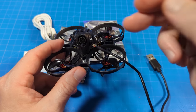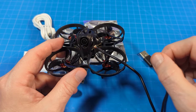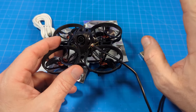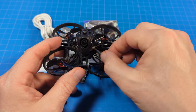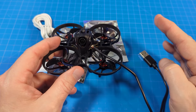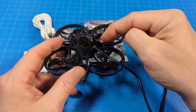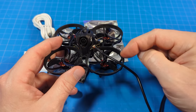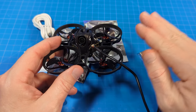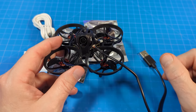It can fall out, so if you're handling this thing while you're pulling DVR files off of it and it gets disconnected on Windows 11, you should see an error. Don't click that error — just get it back in there and then click OK, it will move on to the next file. When it's done copying off all those files, go back to the file that it skipped. It'll still be there if you follow that process of not clicking OK and just moving on, then recovering that file after you've gotten everything else off.